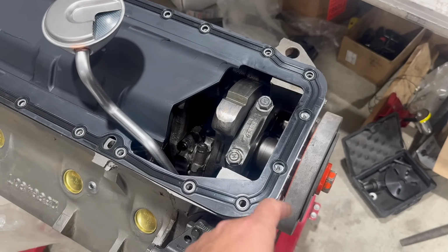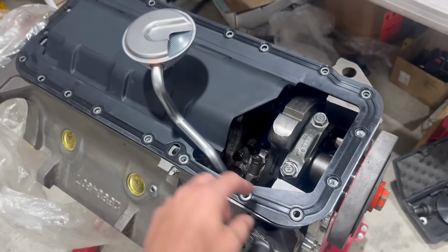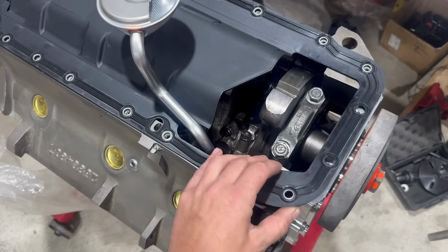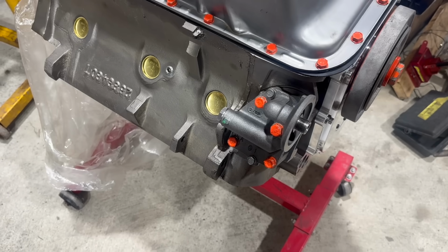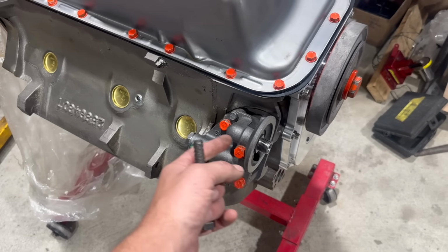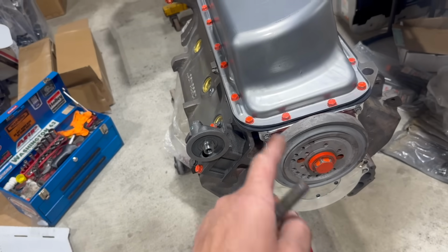It's the next day, and I think I've solved this problem by removing the little steel inserts from the front two and the rear two bolt holes. I should be able to kind of sort of average it between front and back and make it work now, I hope. I borrowed a high volume oil pump from another project. We're ordering a replacement for that. And I got that swapped on here. I feel a whole lot better about it knowing what this engine is going to be capable of.